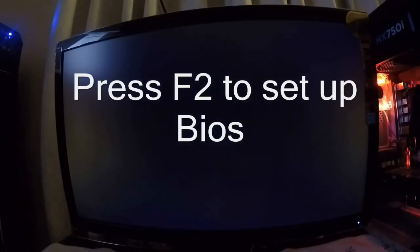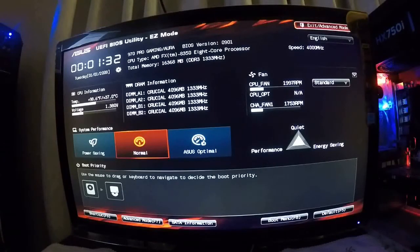And I just hit the reset button on a computer. And it comes back up and says it's a missing operating system, but that's just mine. We'll go back into the BIOS, reboot it. Sometimes you might have to clear the BIOS jumper. Go back into the BIOS. There. I recovered them. It usually takes about 4 to 5 minutes.